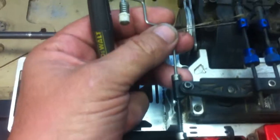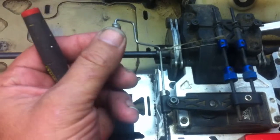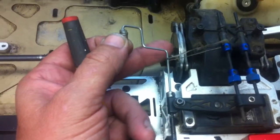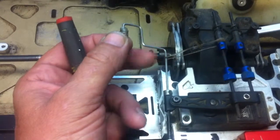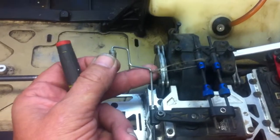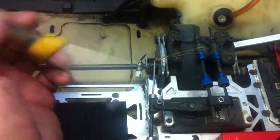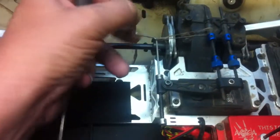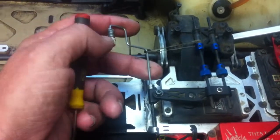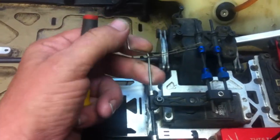So what I did to keep it at the correct angle — this is connected to the carburetor so there's no problem there — but some support is needed right here where my finger is tapping. What I did temporarily was tied a piece of dental floss from here up to the brake linkage. This piece of dental floss keeps this linkage straight, parallel and even all the way through the whole cycle of the throttle stroke.